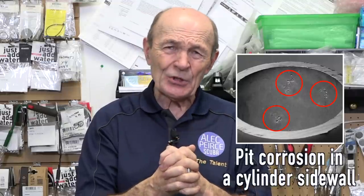However, as far as the tumbling goes, we should try to avoid it. There's no good reason to tumble unless you have a mild case of rust to take off, or if there's some other corrosion. If the corrosion in a steel tank in particular is fairly deep, you can tumble it all you want - the tank will still fail, because you cannot take the entire interior of the tank down to the level of the corrosion. If you have corrosion that might be a thirty-second of an inch deep in a tank wall that is less than a quarter of an inch, the entire interior of the tank has to be taken down to the level of that deep pit. It's just not going to happen. So you have to be very, very careful.